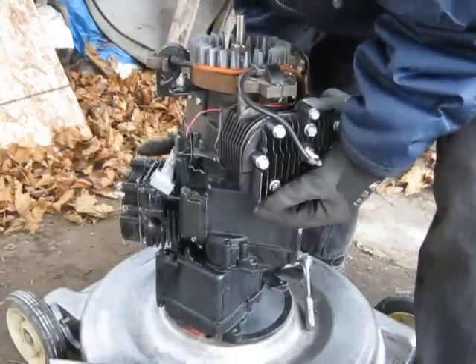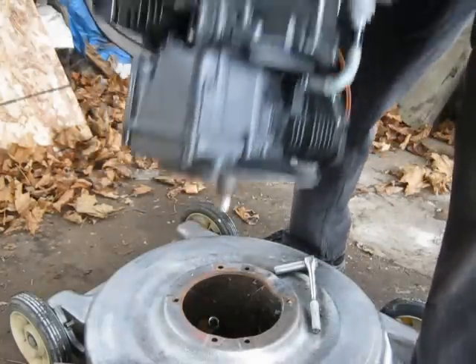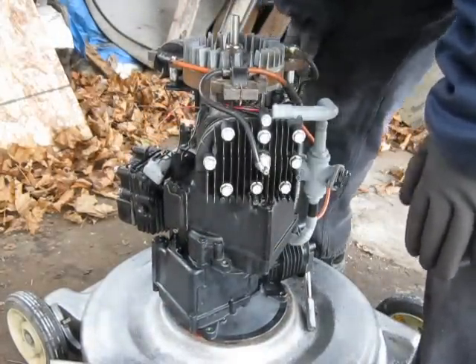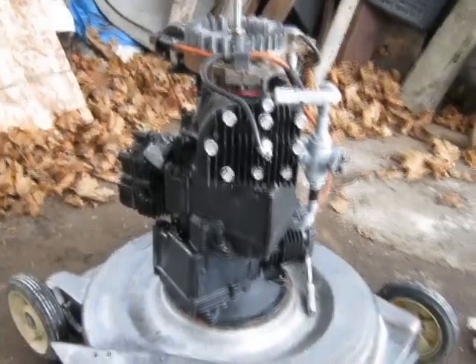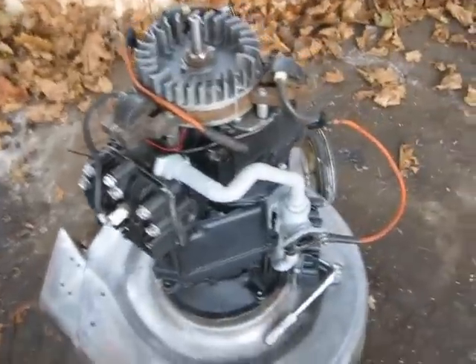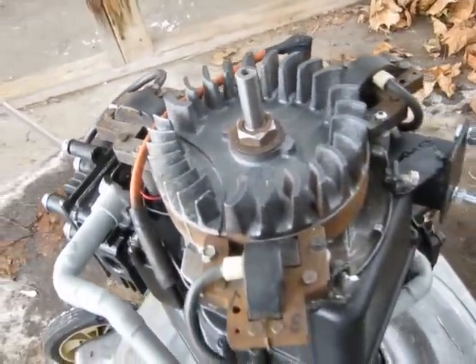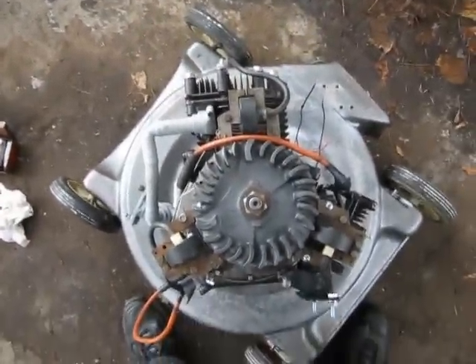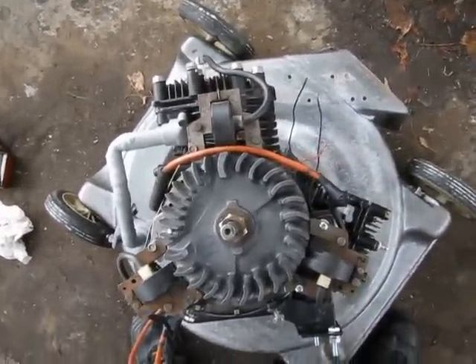What I noticed when I tipped it was this - noises you don't want to hear when you're draining the oil out of your engine. So in other words, it's possible number three let the rod go. I will tear it down and find out fairly shortly. I've got some wear on my starter nut there from jumping around, not having it completely on when I hit the starter. So I may have some deeper repair work to do on my Briggs three-cylinder stacker-type radial here than I thought.